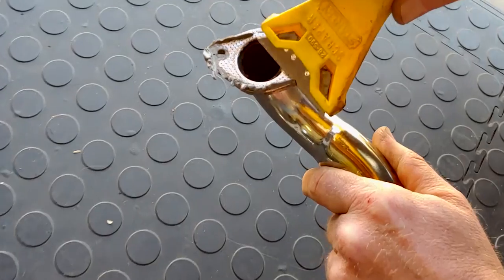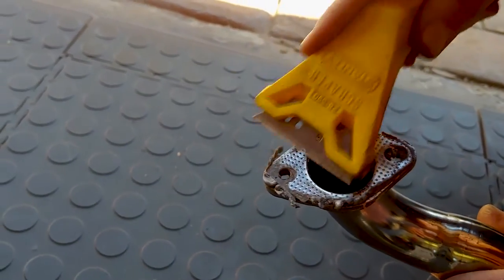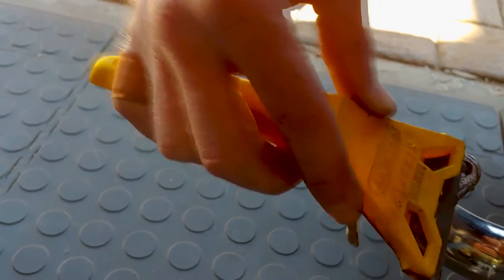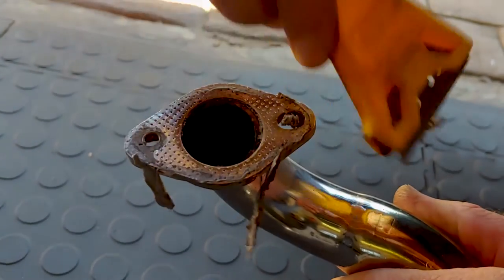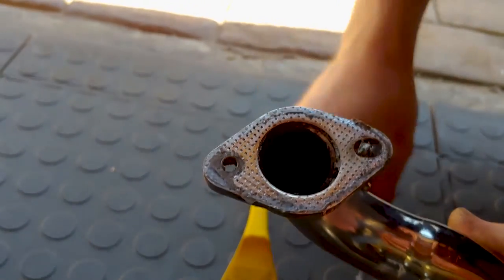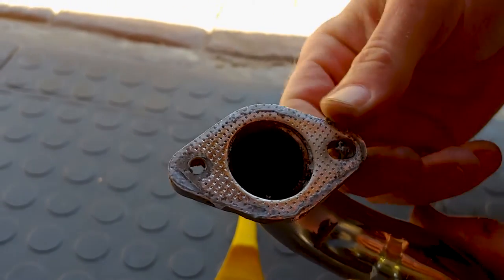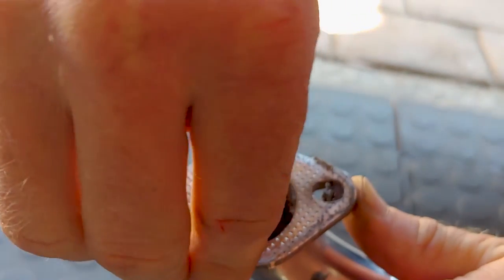It's exhaust time, but all that old gasket sealer has to go first — scrape it off, then take some carb cleaner and clean the overall mating surface so that you have a nice seal. It's quite a big flange for a little bike. Because we have a new barrel, we'll take some carb cleaner and clean that mating surface as well. On a used barrel with cement-type gasket sealer gunk, it would need to be cleaned in a suitable fashion.